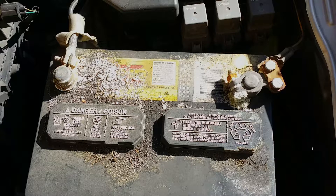You have a problem with your battery. You go into your car, turn your key on, and your car makes no sound. You may notice that your lights come on and get dim really bad, or you hear a clicking sound - just click click click click. Turn your key off, do it again, and it clicks again.